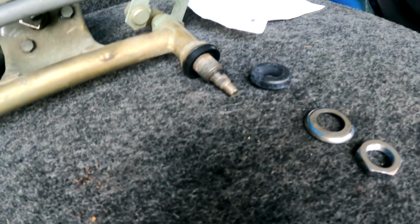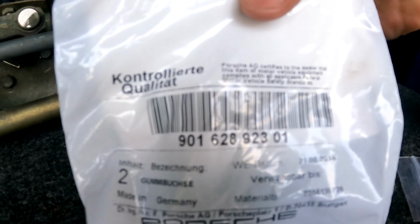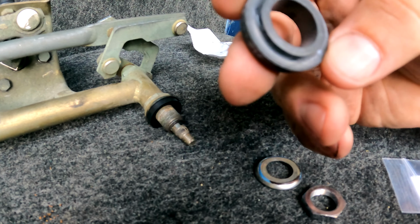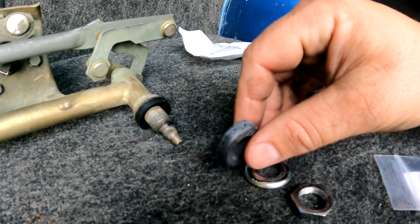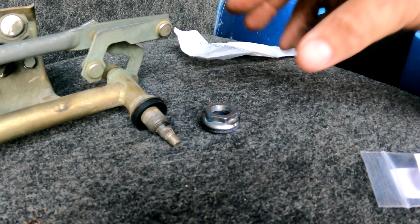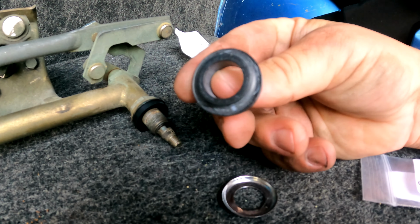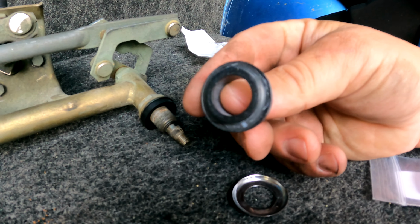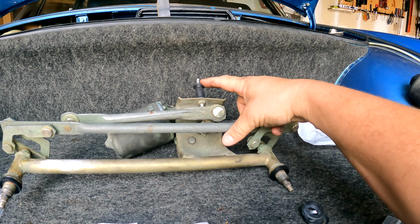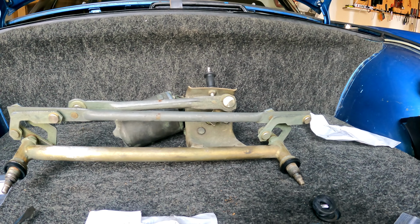So here's a quick explanation on those seals. This first seal, this one, goes in the inside. This one that has this recess goes in from the outside. Then the chrome, then the washer, then your wiper arm, and all the pieces like that. This little recess kind of helps center it in the opening for the wiper arms. So we're gonna go ahead and put this thing in place, and I'll show you guys how to get to this from the backside, which probably does require removal of the speedometer.